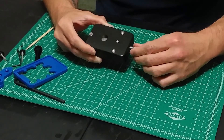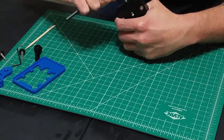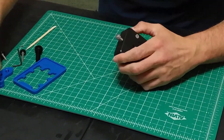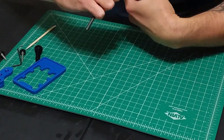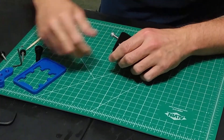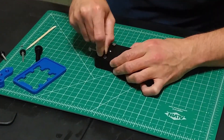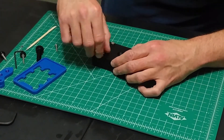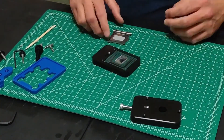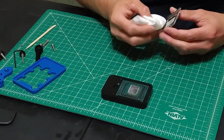Now that the CPU is in your kit and the top and bottom are attached, it's time to pop the IHS from the PCB. To do this, you start by hand-tightening the bolt sticking out of the side of the kit and then move to the supplied allen wrench. You want to do this until you hear the IHS make a pop sound — this sound is the sealant used on the IHS breaking. The sound is very unsettling but normal. Once you've broken the IHS sealant, back off the bolt and remove the screws from the delidding kit. Open up the kit and remove the CPU's IHS, which should be fairly easy to peel off. Once removed, I suggest putting the CPU back in the kit and looking over your CPU and IHS, making mental notes of anything that looks easy to accidentally break.